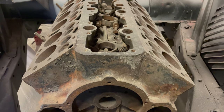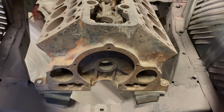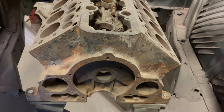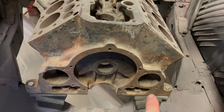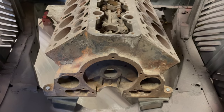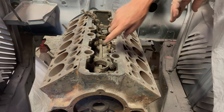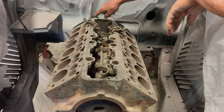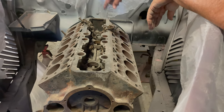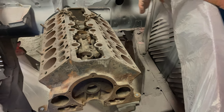Those two holes represent two water pumps on this vehicle, and there's a water diverter up inside each one. To get even distribution of cooling, you have to send the water to the back of the block in order for it to do a proper job circulating and drawing the heat. The diverters send the water to the back of the engine so it cools more completely — if the water just circulates in the first cylinders up front, it's not going to do nearly as good a job.